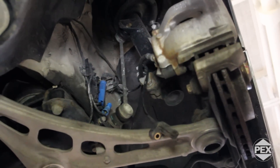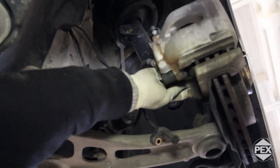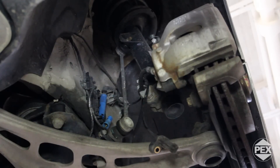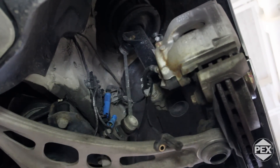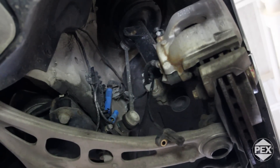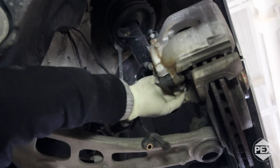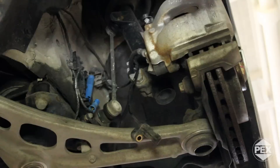What I'm doing here is applying some grease in the opening that I've cleaned out. The reason we're applying this grease is because we need something that's going to reject water and dirt from entering this area. Once water gets in there in the winter it freezes up, it can break the sensor body, or water can accelerate corrosion. So I'm adding a little bit of grease here, and I'll also add some on the sensor body before we install it.